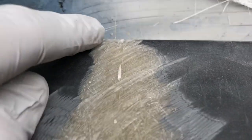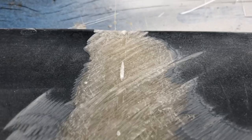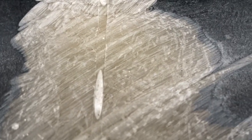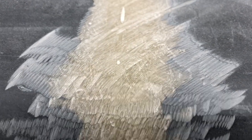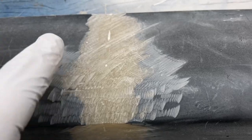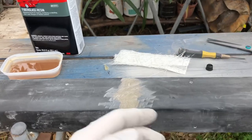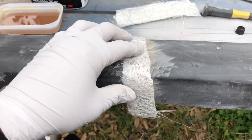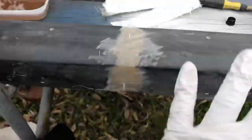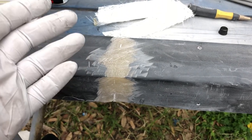I ended up sanding it down really deep so it could be smooth and you wouldn't have any unevenness. I went down to smooth it out and feather it into the fiberglass on the bottom, so now technically it's flush. I cut a few pieces out and I'm just going to lay them like so. Then we'll come back and sand it down with a block to make sure it's straight, and then apply the Bondo to fill in the imperfections.